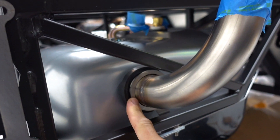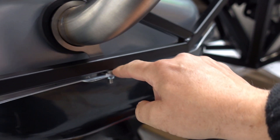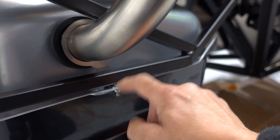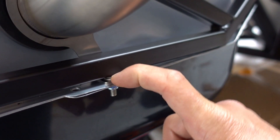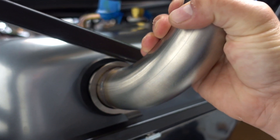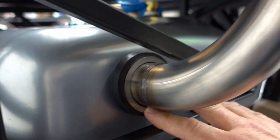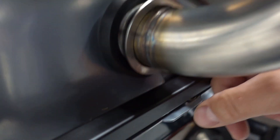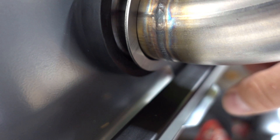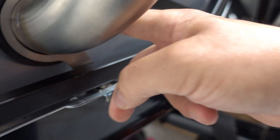First thing: this little ring that goes on the fuel filler — there's a hole already in the tank to secure it. And I think that's fine. But the problem is you can't put this on with the tank mounted and installed, which is what they suggest. So I had to put this on first, which means the filler tube had to be in. I'm still not entirely sure this is correct because I think this should be farther back. So I may have to revisit this and maybe we don't use this hole. Because you can see there is space down here where if this were farther back there should be a hole, and you can mount it. But if you're using this hole that already exists in the tank, you can't mount that with the tank installed. So I may have to take this tank back out and move this.